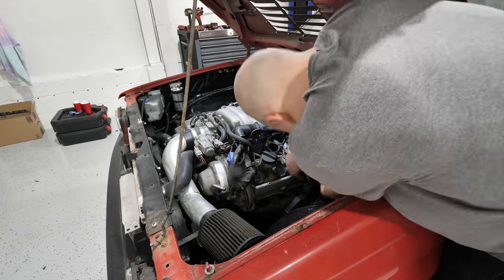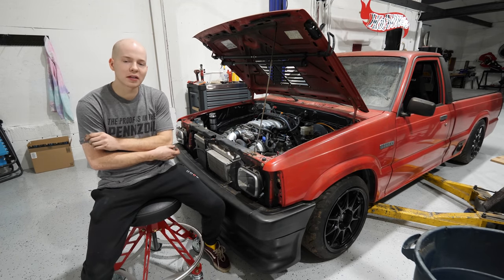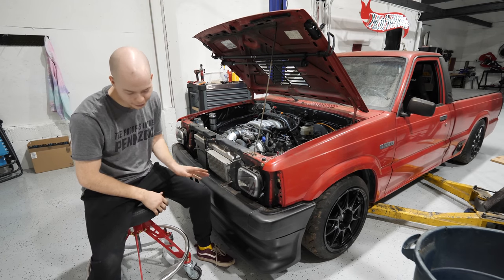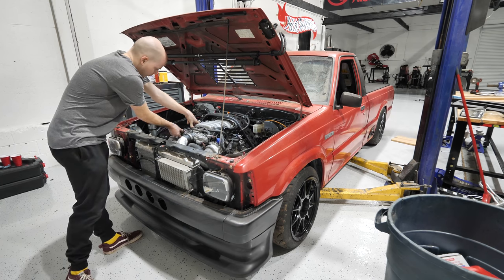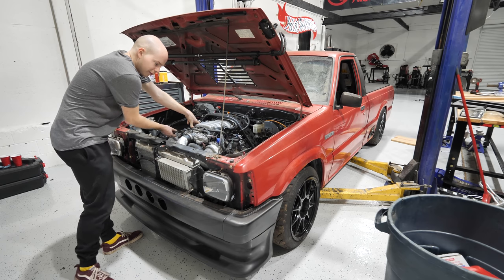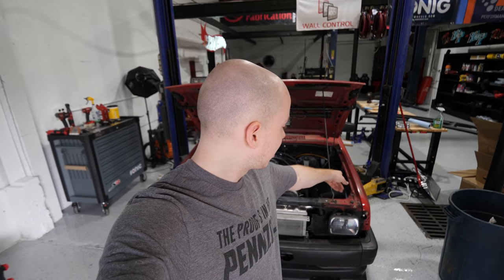Let's give it a shot — if it doesn't work I'm gonna cry. The fact that this motor was on the ground a few hours ago is pretty crazy. Hunter's five-year-old-whatever-miles starter worked, grinding the teeth into it worked, it is back together and it works! I'm going to fire it back up, let it warm up, bleed the power steering and coolant, and before we drive it I've got to put the front end back together, give it an alignment, and put the spacers back on.